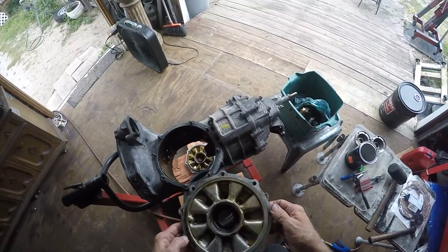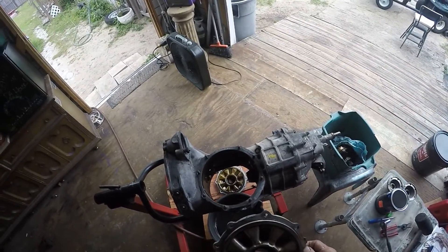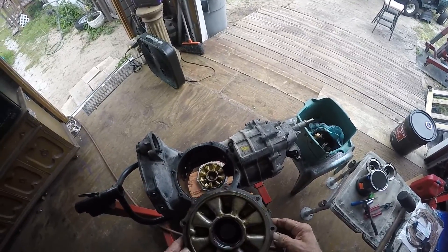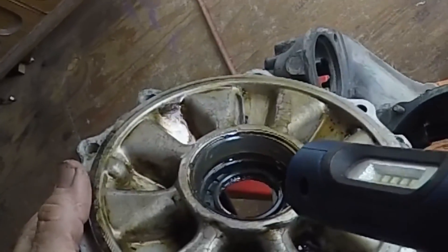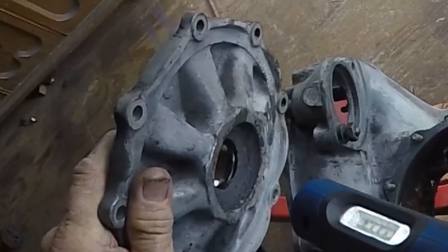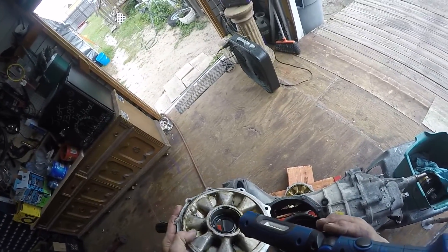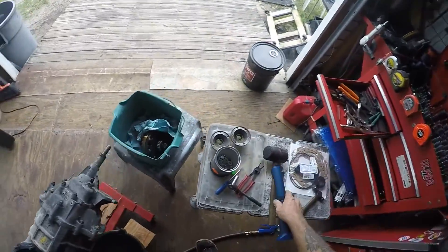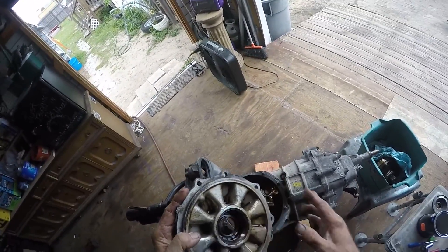I've got it all apart and I see the failure. When I was underneath the car doing the video, the left side is what I was on when I was showing the failures with the mounts. The seal is cockeyed over here, and on the other side it's not disturbed — it didn't come out like that while I was taking it apart. So that was the side that was leaking the most from the final drive. It's nice to see a failure, but these seals have been in there for a long time.